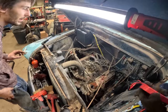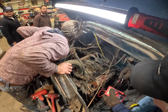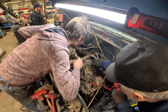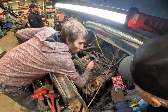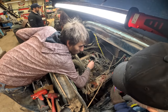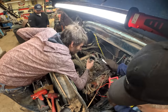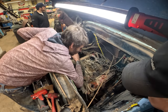Okay. We'll see if we got power there. Well, one of the things that you want to watch and check for, first of all, is voltage. Somebody took my meter. Okay, see, we got 10 or 11 something. All right, we're pretty close to the 12. So our resistor's good. So now let's turn the key on. Now watch your fan.